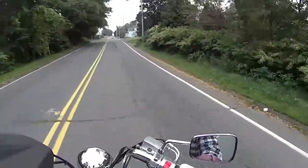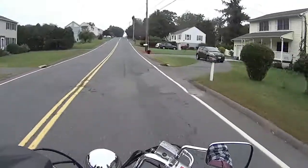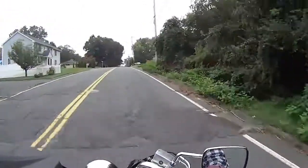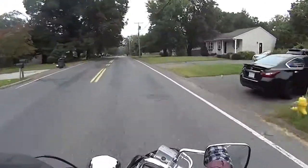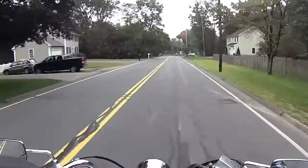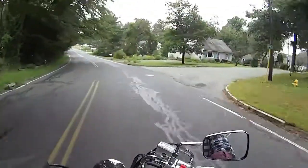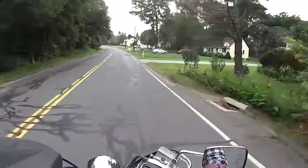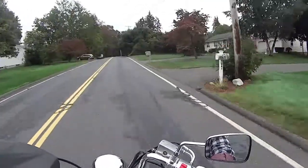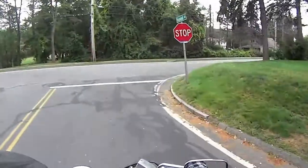The time that it did work was when I did a tire change on the KLR 650. We did a little soapy water test, and some of the air was escaping around the valve stem of the rim. So as a precaution, after we readjusted the inner tube, we put some slime in, and on the ride home from Cleveland to Massachusetts, the tire didn't lose but maybe 5 pounds of air pressure. I figured I would address the issue when I got home, but the leak sort of just went away. So I left well enough alone, so to speak, and was satisfied with the performance of the slime in that situation. So it seemed like a good opportunity to do it again on this Vulcan 900, which also has inner tubes, but that did not work.